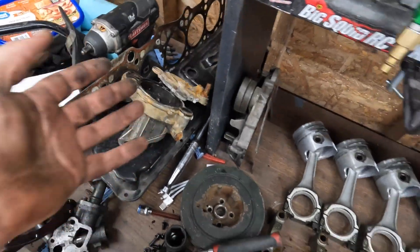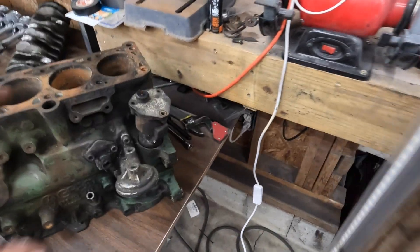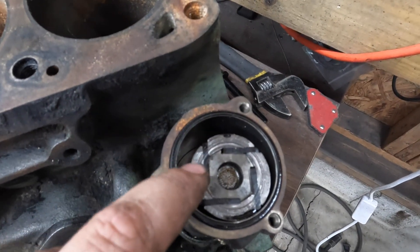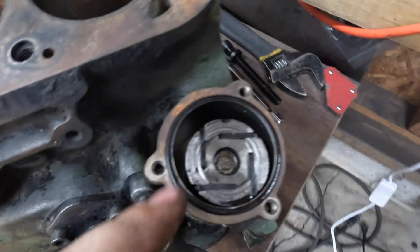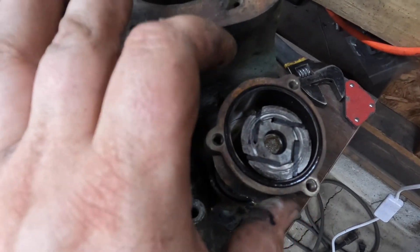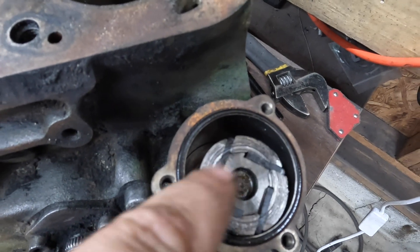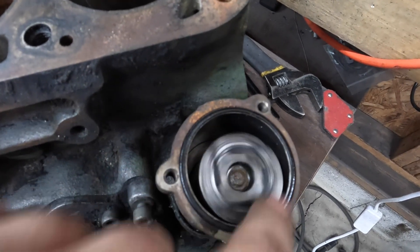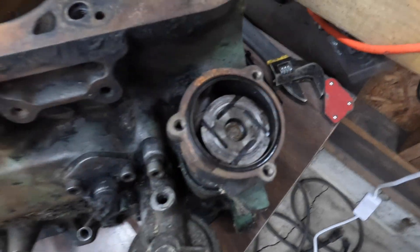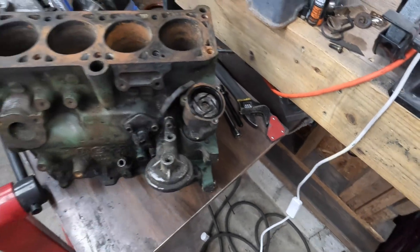This thing's seized and pretty much trashed. The early 1.6s had a diaphragm-style pump with the eccentric cam lobe; the later ones got the vane-type pump. I took this apart to demonstrate how bulletproof they are and how they don't break like the vacuum pumps — but this one's actually broken. We can see the galling right here. These vanes, as it spins around, it's like a reverse air motor in a die grinder: instead of running off a pressure, it creates a vacuum. The vanes would slide out from centrifugal force, but this galling from metal getting in there has jammed them. This could probably be saved. Also the check valves like to break off, but you can just JB weld a brass nipple in there and use an external check valve.